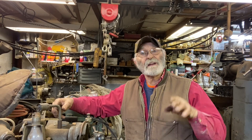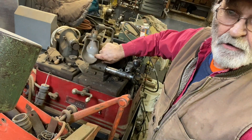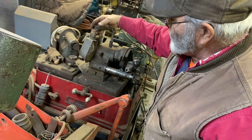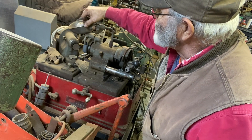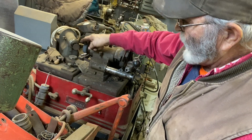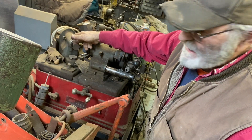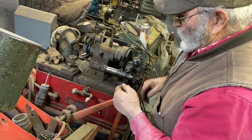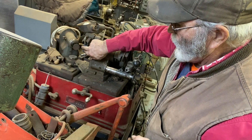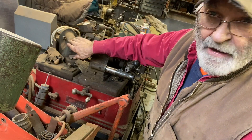Today, hopefully, is going to be no exception. We have one valve that we're going to touch the tailpiece up on. What you're looking at here is an old valve grinding machine — it needs a little bit of work; my light has come a little disconnected. But here's the portion where you actually grind the surface of the valves and put the multi-angle surface on the seating portion of the valves. This indexes back and forth, and there are machining adjustments in thousandths of an inch on that portion of it.